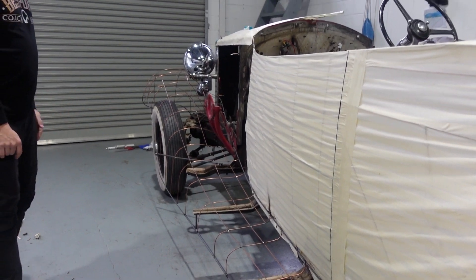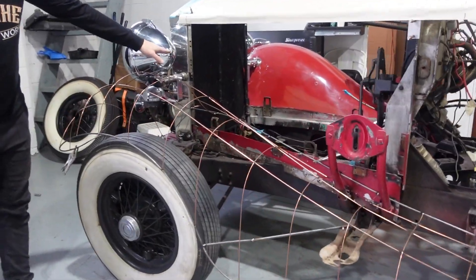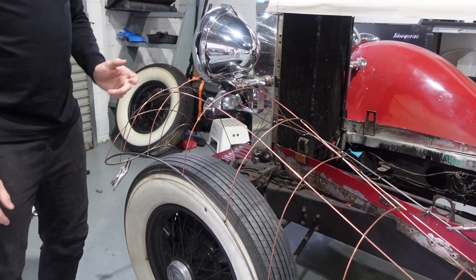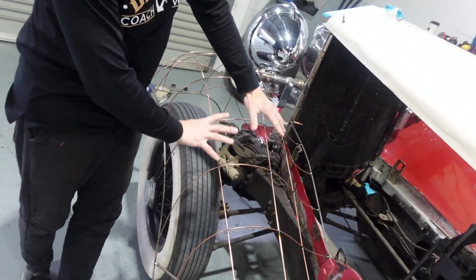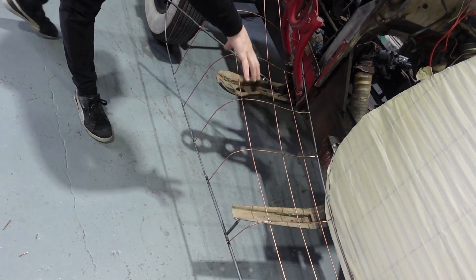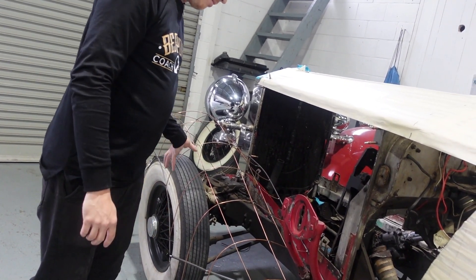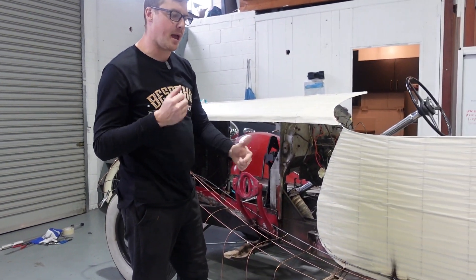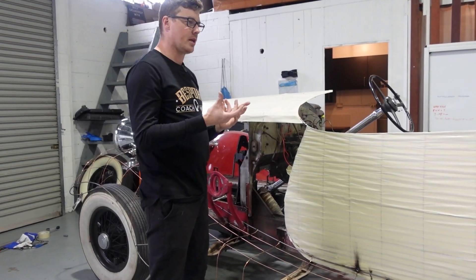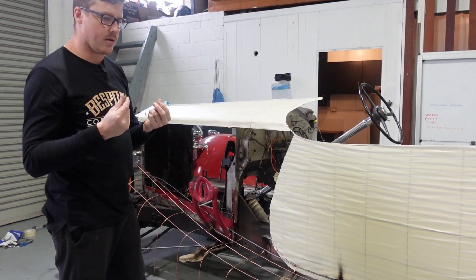I've just tried to cut a lot of the height down in the guard. The old guard would have come up to about half the headlight here, so it's dropped down probably 50 to 75mm. I've tried to keep that volume in it a little bit longer — the radius is still quite heavy and then only starts to taper out back through here as it gets closer to the door edge. But it's a lot of consistent shapes. One of the things I like to try and do with my designs is repeat shape — so you can see correlation when you look at one thing and you see another part of the car and they look visually very cohesive.